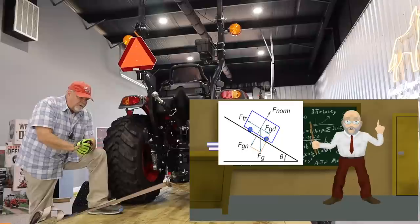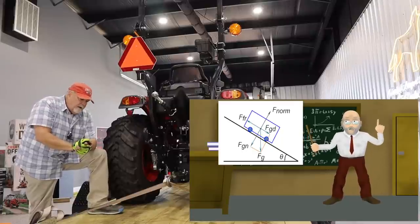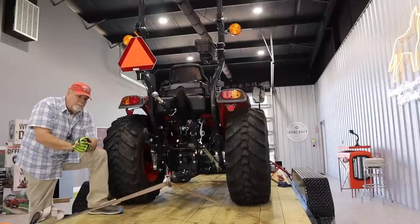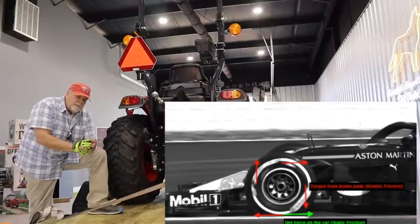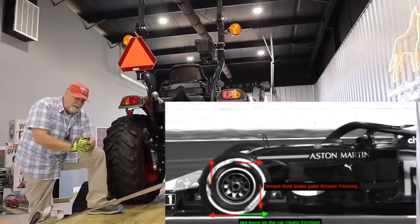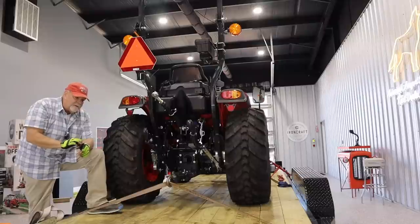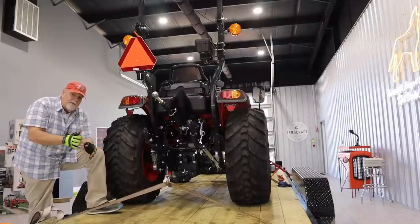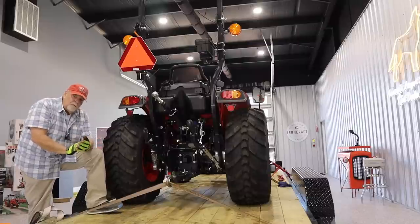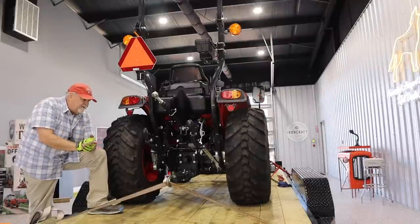Your high school physics teacher would explain that the way braking works is you're turning one energy into another. The energy of motion through friction causes heat and heat dissipation. So you're turning motion into heat and it dissipates off. That's what brakes do: by use of friction, they generate heat, and then the heat is blown away. But if the brakes get too hot, they cannot do that function. So try to keep the brakes cool by using them slightly more aggressively and less often if you're on a long grade, and certainly downshift the truck manually if that helps.